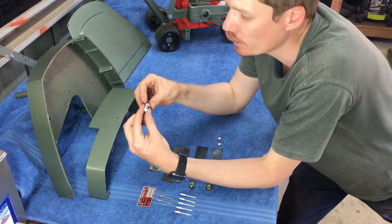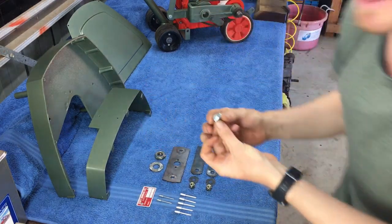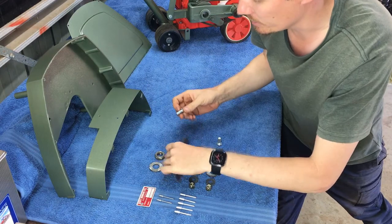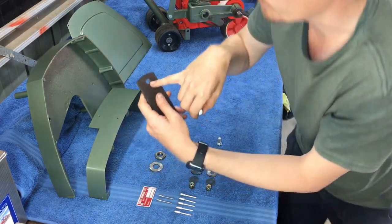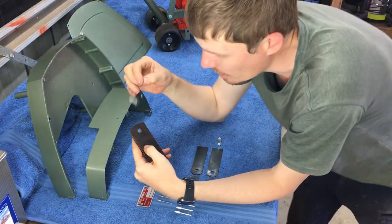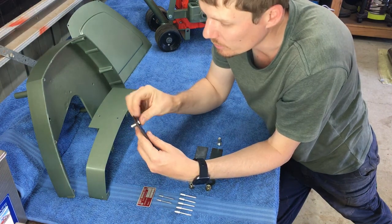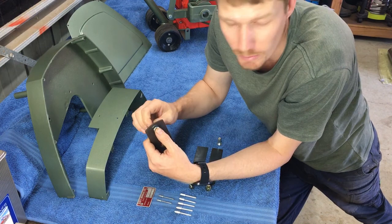When you buy the brand new blades, these bolts are a bit of a funny shape. They've got a flat edge cut off them. Now that flat edge is there on purpose. You'll see that the blade holder actually does not have a round hole. The actual hole itself is an elongated hole. That's designed for this bolt, so this bolt will slip in there. Now that bolt can't actually undo or rotate, I suppose, more than anything.